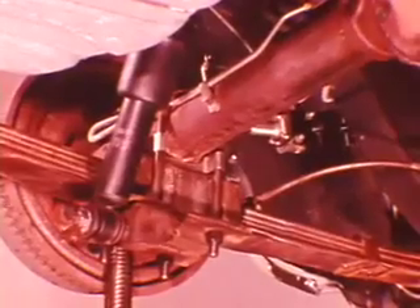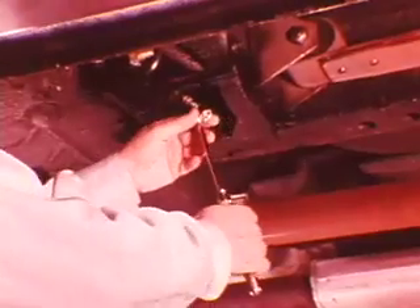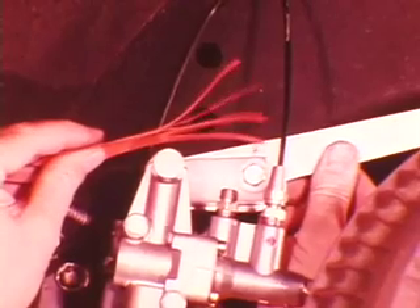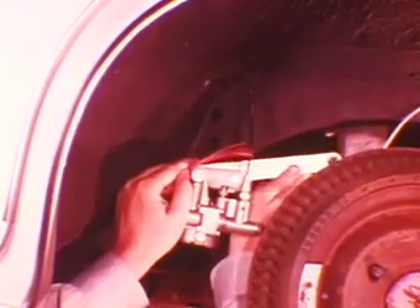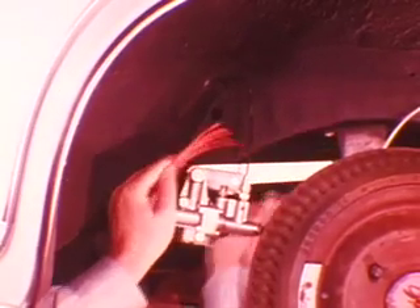To check height control valve operation, disconnect the U-bolt linkage clip from the rear axle by prying the rear section out, then the front section. Make sure there's at least 100 pounds of air pressure in the reserve tank. Disconnect the air pressure tubing leading to the shock absorbers. Move the height sensing arm upwards — this simulates increasing the car load. Air pressure from the reserve tank should begin to exhaust from this outlet in about one minute. Some sensing valves may have a longer time delay. If air does not escape, lower the arm to the neutral position and then back to the up position and wait at least one minute. If there's still no air pressure being released, the sensing valve assembly must be replaced.